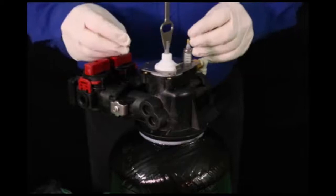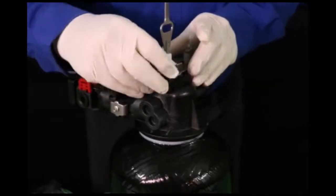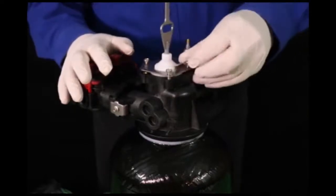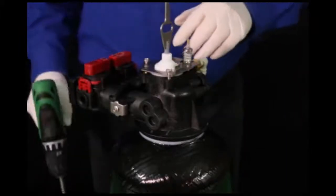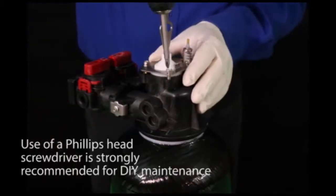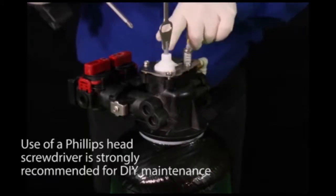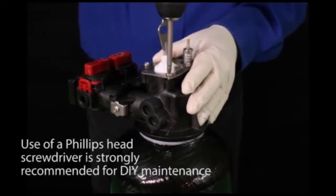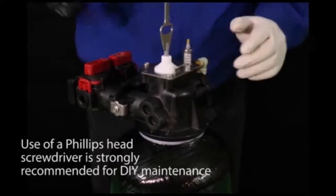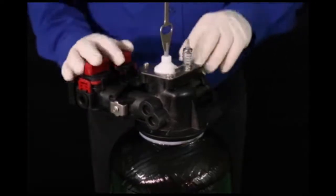Put your bolts back in. If you've done this before, you'll know where your bolts go. If it's your first time, take a picture — I always teach my service people to take a picture if you've never torn it apart before, so you know how it goes back together. Now, if you've ever changed a tire, we don't tighten all the lugs one at a time — we go around in a criss-cross pattern. We do that here too: a little bit, a little bit, a little bit. As I do that, this plate will push everything down where it belongs — everything compresses, everything's in place, everything's tight and snug. That's why I set the torque down at 50% so I don't damage anything. So that's how you remove the piston seals and spacers and the brine valve from a 6.5 control.